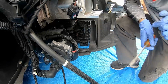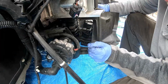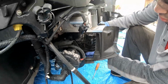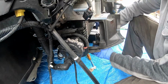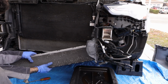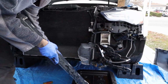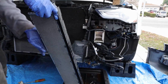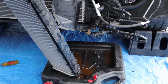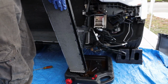What's the hardest part? Is the hardest part putting the pulley in? Nah, that's the easiest. Just like that, take that off right here from the top. Put the flathead in like so, move it to the left, and you've got to be careful with it. Start taking it off. That's when it's pulled out. Just let it drain for a little bit. And then, that's how you take out the stock heater exchanger. You don't need the T30 bolt. Just let this drain, and then of course recycle it or give it to whoever needs it.